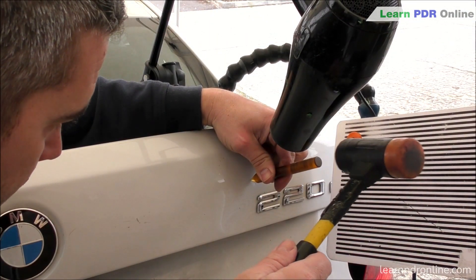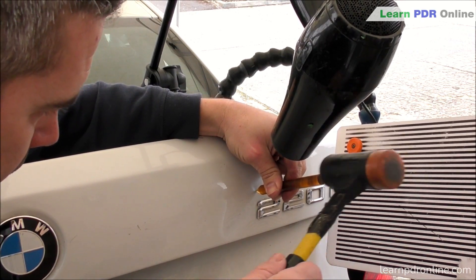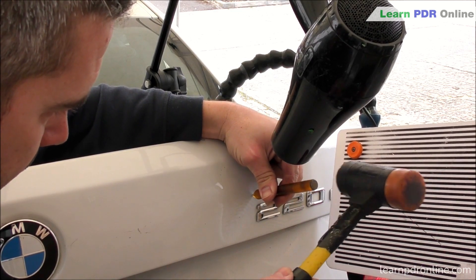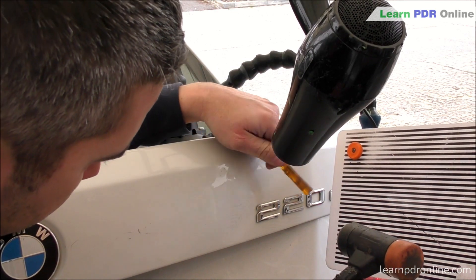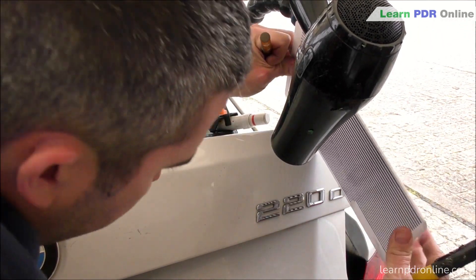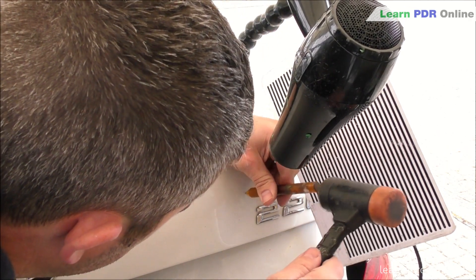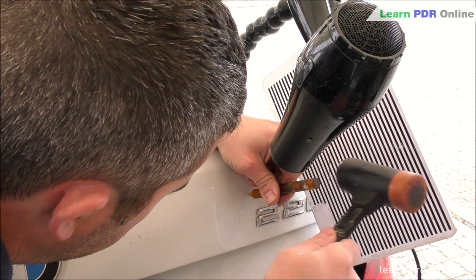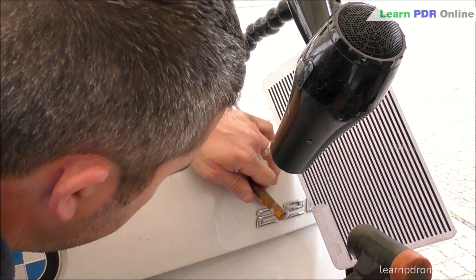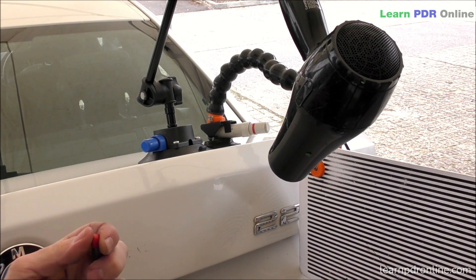You'll see me moving my root beer tap down in a circular motion around the dent, tapping down all of the high area while making very sure I am not tapping down the low spot itself. The pushing process only looks to push up the low; the tapping process only looks to tap down the highs. I'm working around that small low spot, tapping down the shoulders and pushing that metal back down - this is known as opening up the dent.